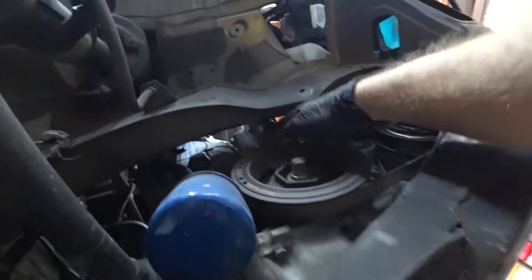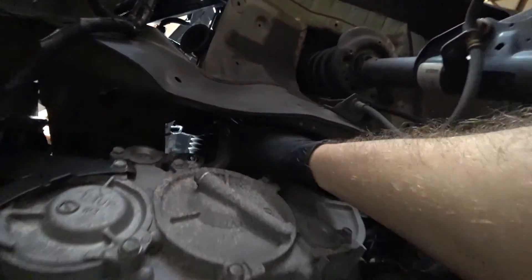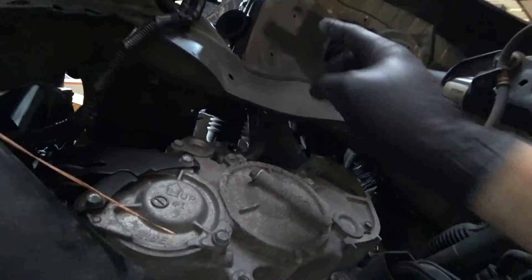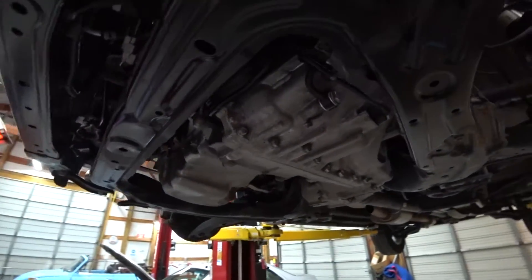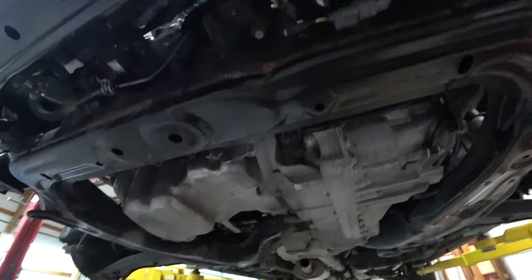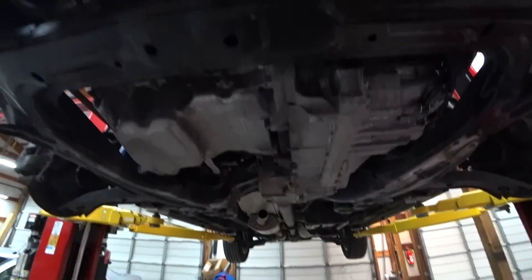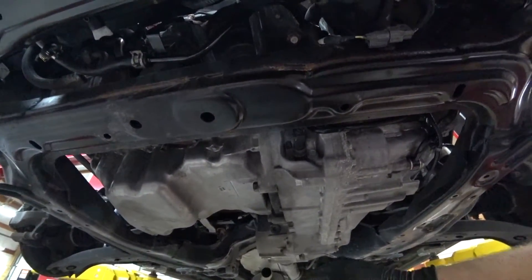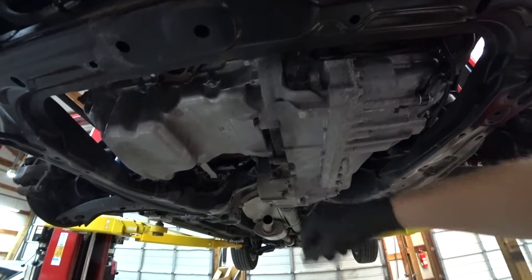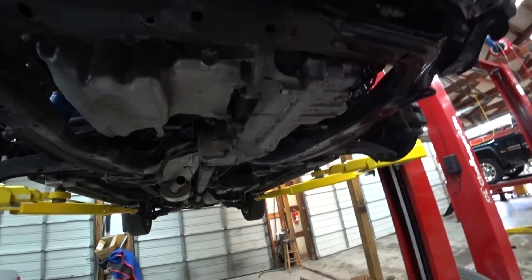Of course it's got two mounts — a mount there, a mount here, and a mount here that connect to the frame and not the subframe, so the engine should stay up in the car. It's got a mount in the back over by the steering rack as well, which I'm very curiously going to get to somehow. I plan to just disconnect those two mounts and hopefully the engine will stay up. I'll use a tripod to support it in case it doesn't, and I'll probably also get an engine hook — there's at least one good hook mount at the top.